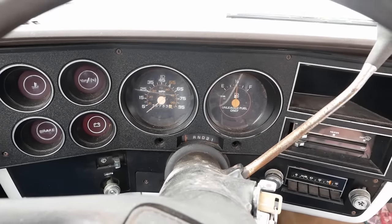I think what's going on here is that the power piston adjustment is too low, so it's a little bit too lean. I believe that has to do with part throttle based on what I was reading. They call it an APT. The idle's good and it runs fine, you know, once it gets past the tip in, but it just stumbles right there. You can get past that and it's okay. So let's richen that thing up a little bit and see what happens.